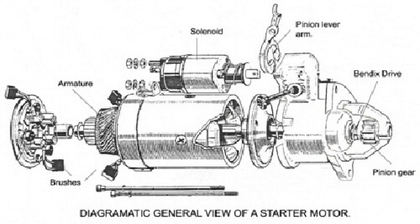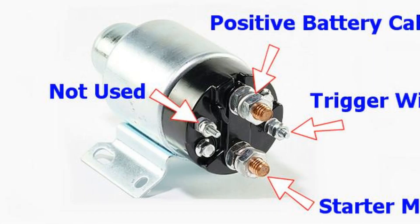The first cause is large wear in the roller grooves, preventing the slave ring from locking. With this malfunction, the starter rotor rotates without extraneous sounds — the sound is similar to a soft buzzing. This is eliminated by simply replacing the bendix. The second cause is deformation of the bendix gear teeth, preventing them from meshing with the flywheel crown gear, accompanied by a cracking sound.